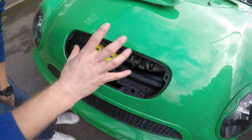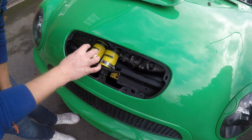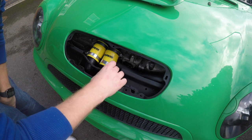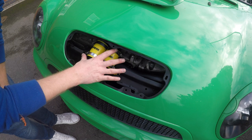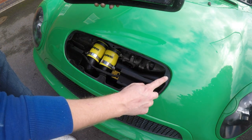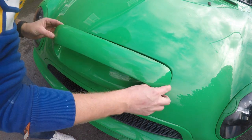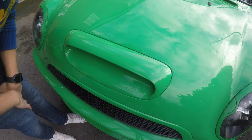Let's get it onto the car. Yours may look slightly different just because my car's been resprayed — we've done some cutting, so the black paint you can see here is just to stop any cut areas from rusting. Yours will obviously all be body coloured and this metal panel will actually join on your one. But that doesn't matter — it doesn't impact how we fit the bonnet scoop. We've got one, two, three, four fixings and one, two, three, four holes. So all you've got to do is literally line up the holes and it goes on as simple as that.